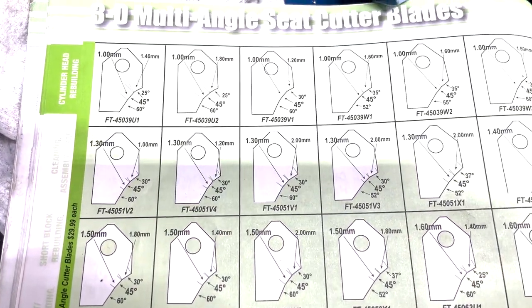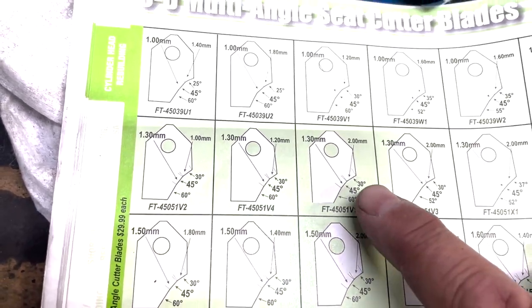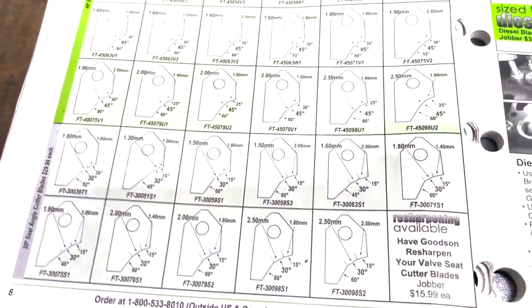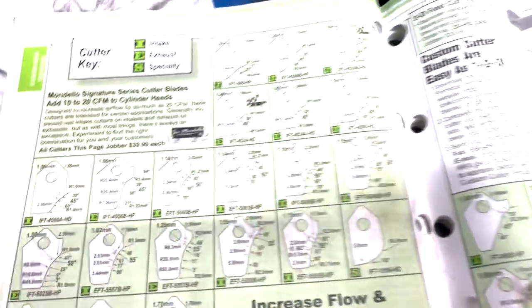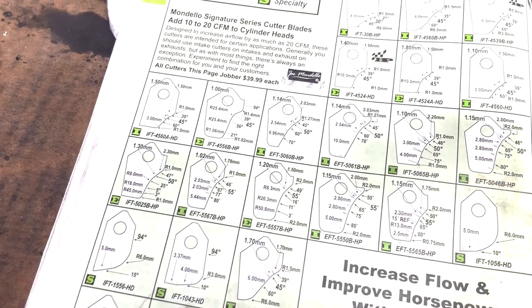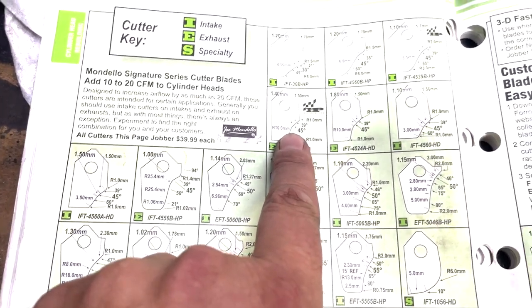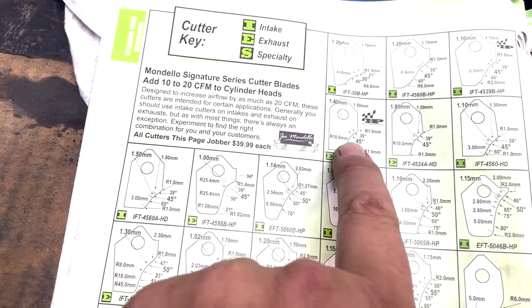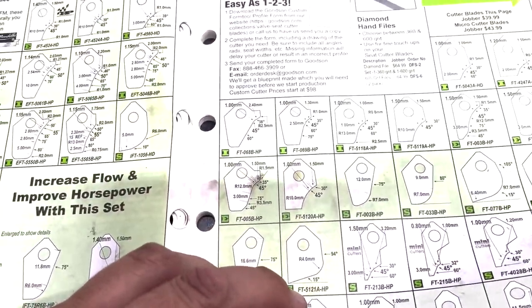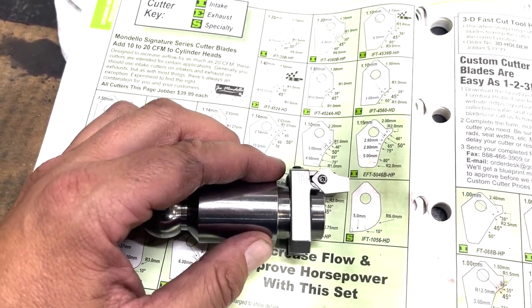To give you some idea, you can see in this book we have a bunch of different cutters described. They describe the seat angle — this one's a 45, with top angles of 30 and 60. That's a pretty run-of-the-mill type cutter. But these things will vary depending on the engine. Over here we've got some more complex ones, more representative of what I use in a racing engine. There's more angles and they're a little more complex. Generally speaking, exhaust cutters will have a radius inside the seat angle instead of more angles. Remember that the seat does different things — the seating angle is where the valve sits and the only place that makes mechanical contact to seal the cylinder. The rest of the angles are really just to aid airflow, to help turn the air in and out of the cylinder.